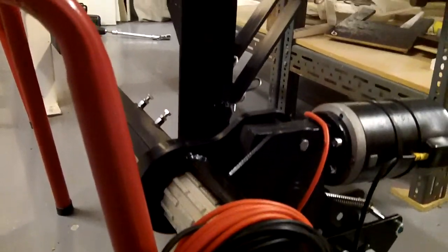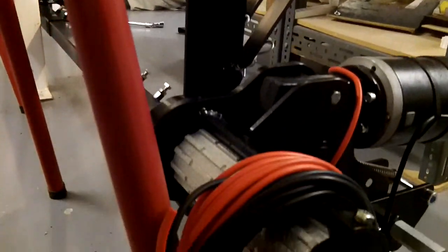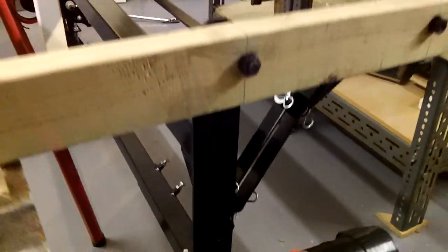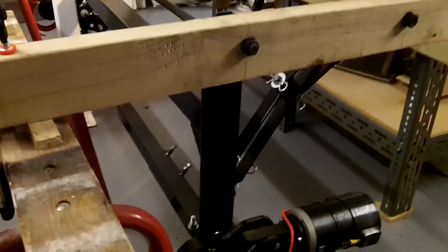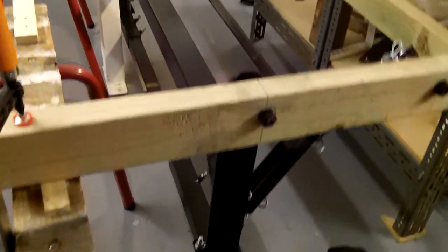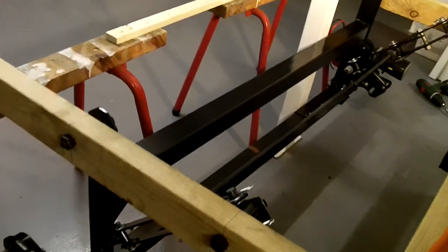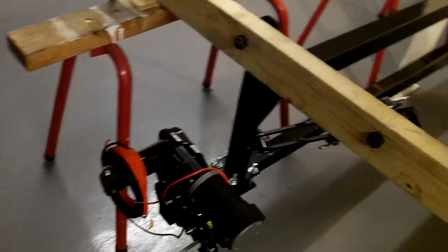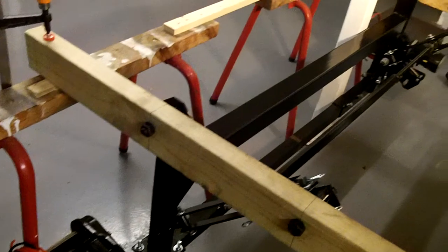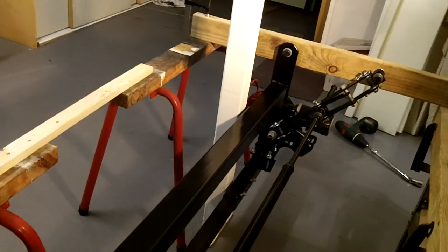This gives you quite a large drop height from the mounting points at the chassis, and the standard brackets which come with the kit are not going to be good enough — certainly not long enough. So in this case we've put together a swing-away bracket system, which means that when the Purple Line system is not in use, it can be tucked away or swung up under the van.